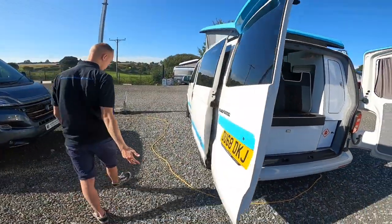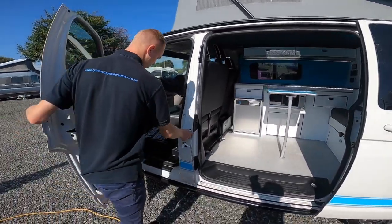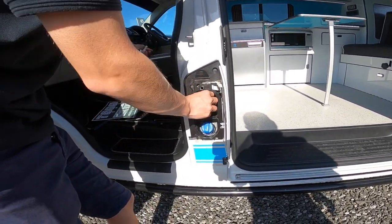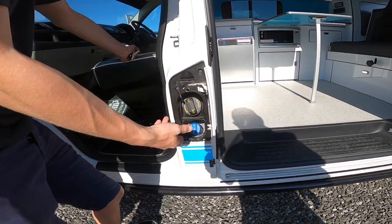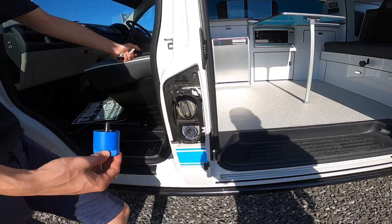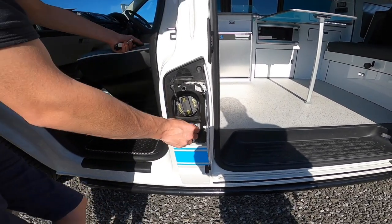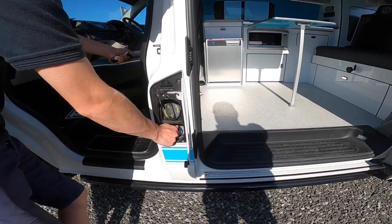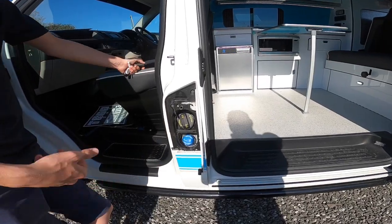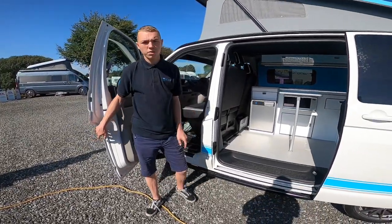Coming around to the passenger side of the vehicle, at the sliding door you've got your diesel intake — just fill with diesel fuel. Because it's a new-style diesel engine it's also got AdBlue. It'll indicate when it needs AdBlue and give you a mileage countdown. Don't let it go completely dry as the engine won't start, and halfway down the countdown it will go into limp mode to protect the engine. You can fill up at the pump — normally cheaper than drums — or buy 10-litre drums; this tank takes about 15 litres from empty to top up.